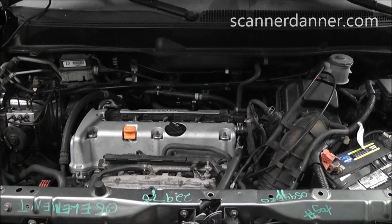Let me take a moment to talk about direction here and where you start. I think one of the difficult things as I continue to film these different case studies is where to take you, where to start, and I don't think there really is one right way to do this. We can go scan tool first, we can look for codes, we could right away look for spark, the coils are easily accessible, we could look at fuel pressure. There's a lot of different directions that we can take. So again, just want to emphasize that my approach is probably different for every car I work on. It just depends on the car, the symptoms, the situation, and what components are accessible and which are not, as far as direction and where to start.